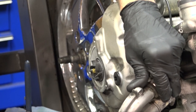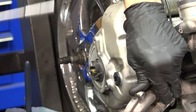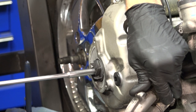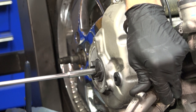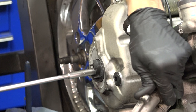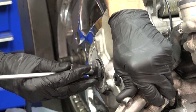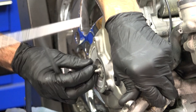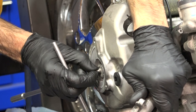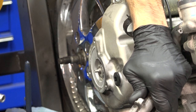I can tell because I can hear the noise out of the motor. I have the oil drain and the cooling drain done. It is possible to do this whole job while the motor's in, but it's obviously so much easier if the motor's out. Go ahead and remove the water pump impeller — typically you want to go reverse thread on it. There's some springiness because there's a spring dampener that attaches it to the flywheel, but I went clockwise and that's how you loosen the impeller. If the impeller is deformed in any way you'd want to service that. You do not want a water pump that looks like a little mini joystick where you can move it side to side.